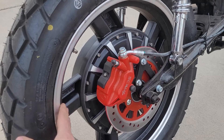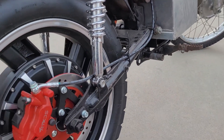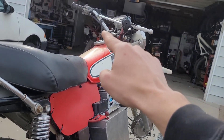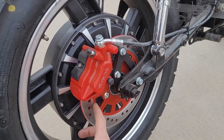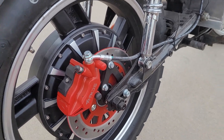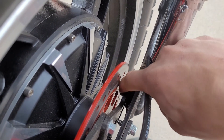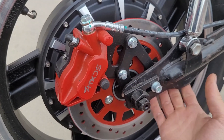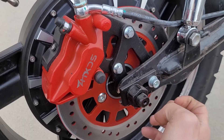This side is actually an upgrade. There used to be a drum brake in here actuated by the foot pedal. I removed all of that, and since there is no clutch anymore, the left brake now brakes the rear — and it brakes very well. All I had to do was weld a little pin here for the caliper bracket, and then the rest of it just slid right through the axle. So that was quite easy to mount.